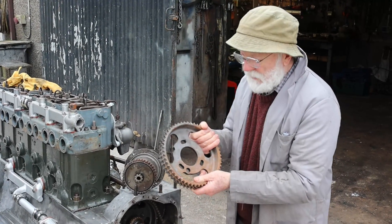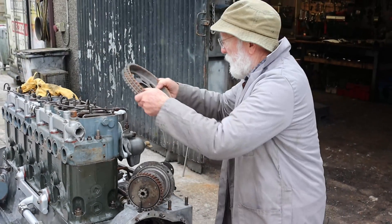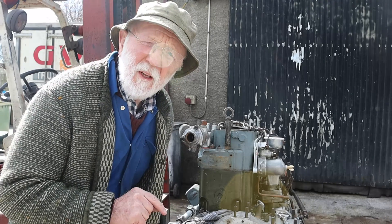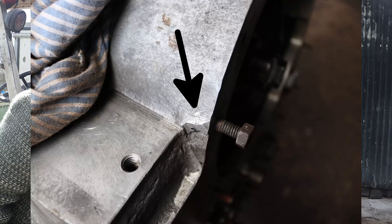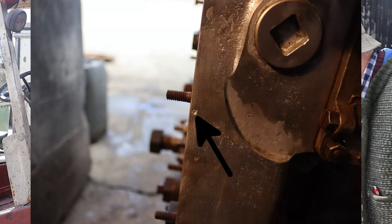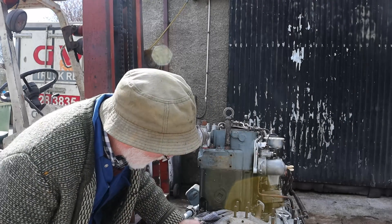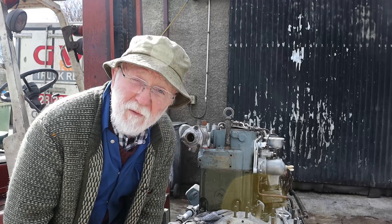If you look very closely you'll see that there are two marks on the camshaft gear — I've just marked them there with white Tippex, they're easy enough to spot. The first thing we have to do is make sure they are in the right position. If you look very carefully you'll see that there are two timing marks on the crankcase — one on the starboard side and one on this side. All we have to do is get a rubber band or a piece of string — rubber band's the best — and pass it from one mark to the other. Those marks are always opposite those particular studs, so you actually don't need to see the marks; if you go between those two studs you can't get it wrong.